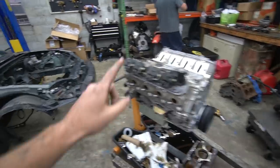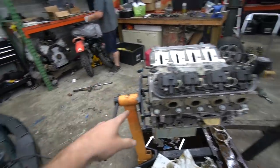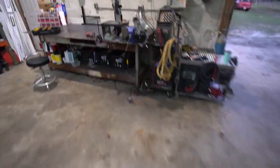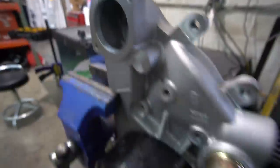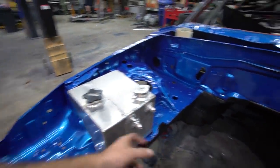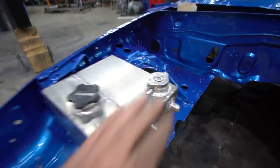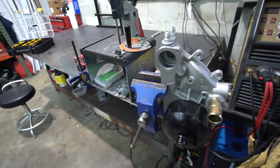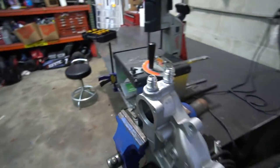The plan is waiting on the clutch pilot bearing to freeze. Once that's done — leave it for an hour or two — we can install that and then install the clutch and trans. While we're waiting, I am going to be welding some AN fittings to this water pump. This is just a stock replacement water pump. Ben pulled the fittings out of it. I cleaned them up — I use regular rubber hose with barbed fittings on mine, but we did AN fittings on his coolant expansion tank. The only downfall is you have to weld the fittings onto the water pump. This is cheap cast aluminum, so I've cleaned it up as best I can. I'm going to try it and see what happens.